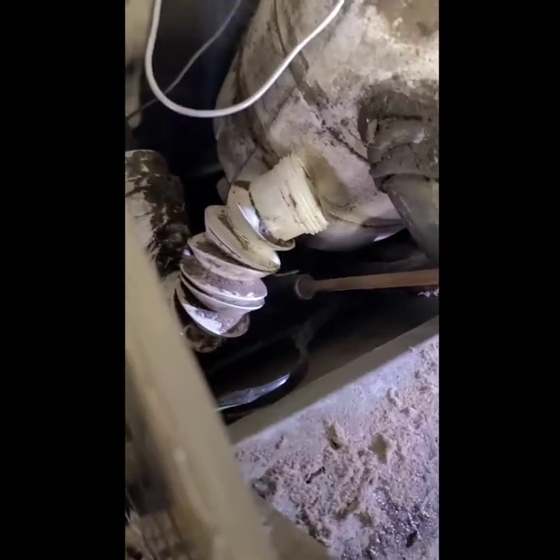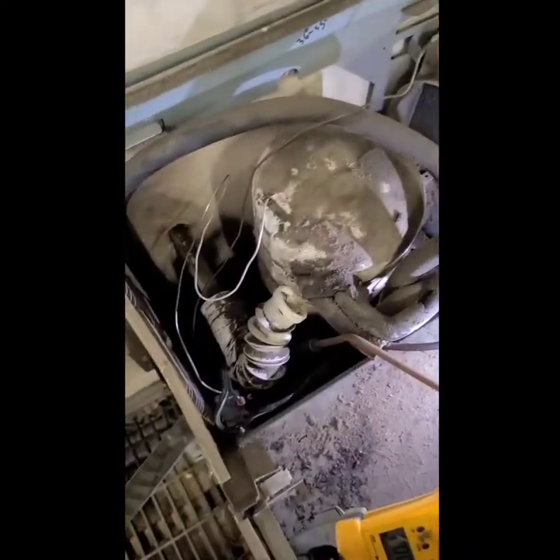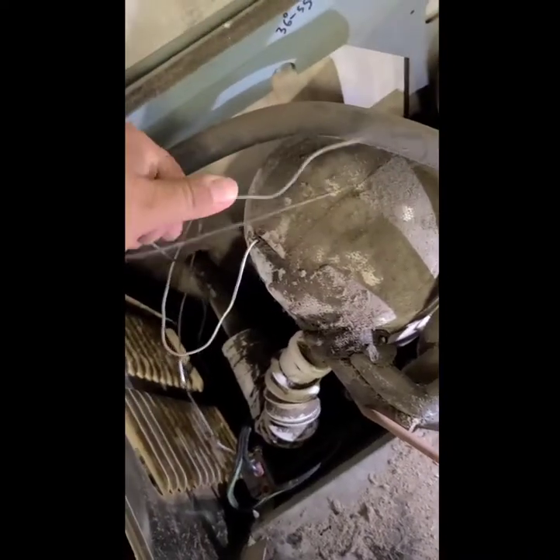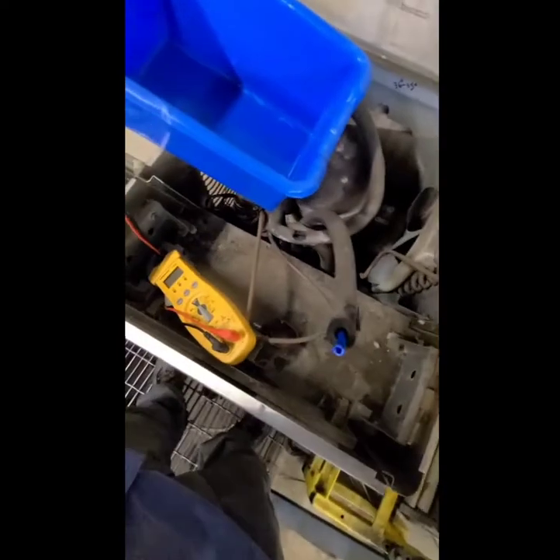Make sure no electrical connections can touch anything, then connect the wires. It doesn't matter which way the wires go — it just sends a signal across, so either orientation is fine. Plug it in — the condenser came on, the control is working, everything looks good. As for the old control, I'm leaving it in there and I snipped off the old sensing bulb rather than trying to remove it.